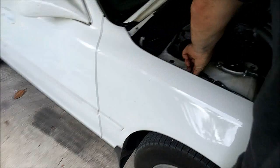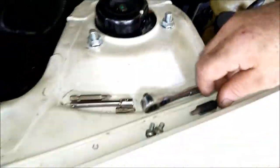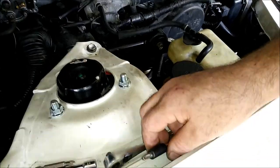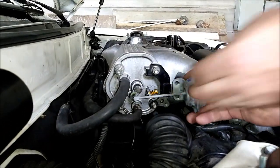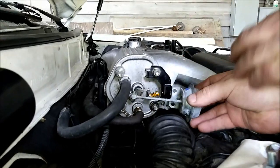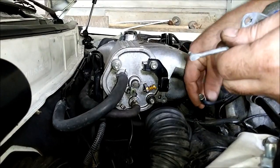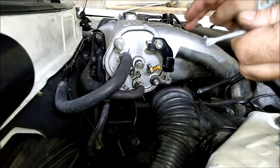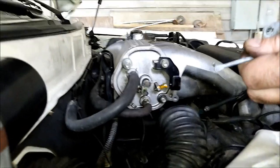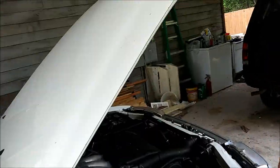It comes off with a little snap clip on the back and two number three Phillips head screws, but you can't get to it easily with a screwdriver. So what I did was set up a ratchet with a number three Phillips head to get to it. I'm going to go ahead and put this new one on, cut the video after we install the two screws, then test it and show how when you rev the throttle it sucks vacuum through this port to open that induction.